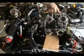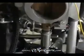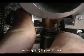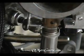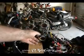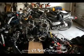So I've installed another limit switch right here so that when the throttles get all the way open, it touches and it takes that resistor back out of it. So when you need it, it will allow the throttle plates to go open faster, and when they actually get wide open, that drops it back out. That's the YCC-T fix number 1. So thought you might like to see that.